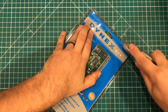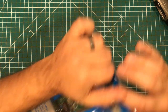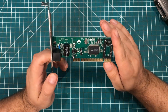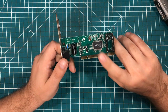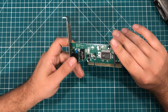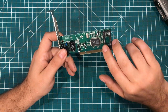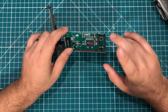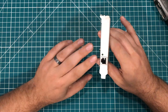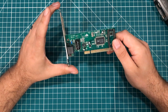I've been getting into some retro computing stuff, not necessarily for gaming, but I need to do some of it for work. This is a new old stock network card. The 8139 chipset is very compatible with old versions of Windows. It also has this ROM slot where I've seen some people do hardware modifications by adding an EEPROM. You can basically add functionality to your computer by putting a chip in here. I wanted a network card compatible with a whole bunch of different operating systems, so that's why I specifically chose this 8139.